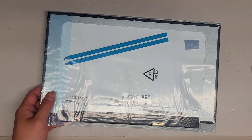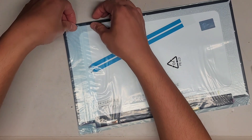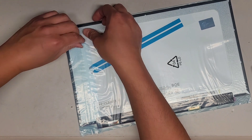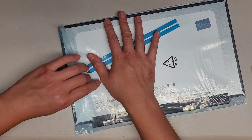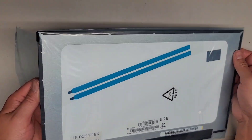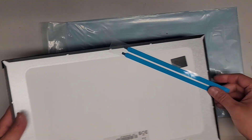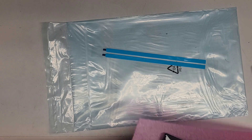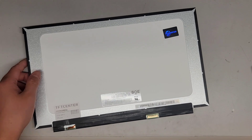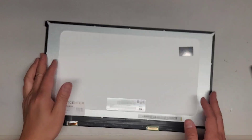Here's the screen. They have a foam pad on the LCD panel. There are the adhesive strips. We'll grab the back part — this does have a protective cover on top. I'm going to peel a little — okay, it is matte. I wanted to confirm it's the same. We're going to go ahead and reconnect the cable. We might have to un-route this cable to have a little bit more slack to work with. Make sure the pins are face up when you do this — you don't want the flat side face up.